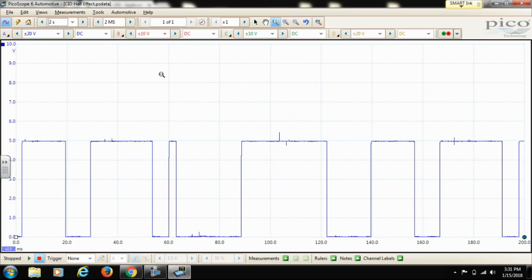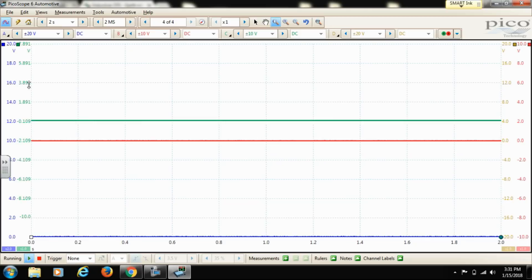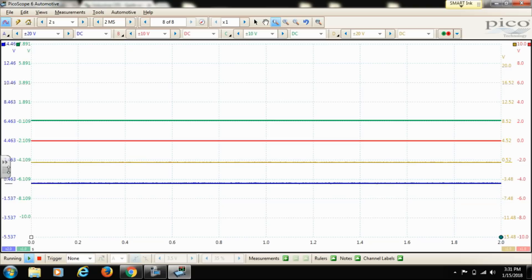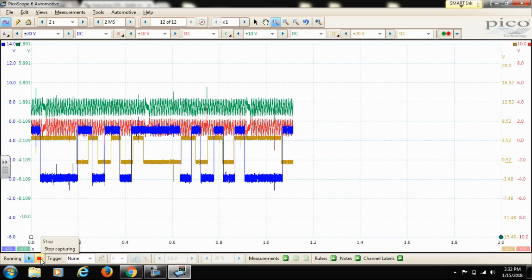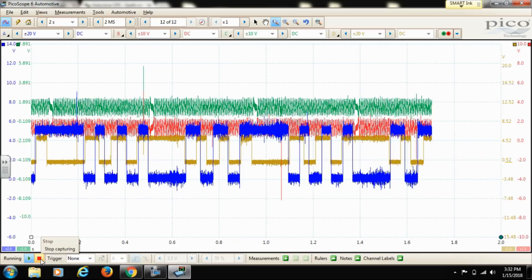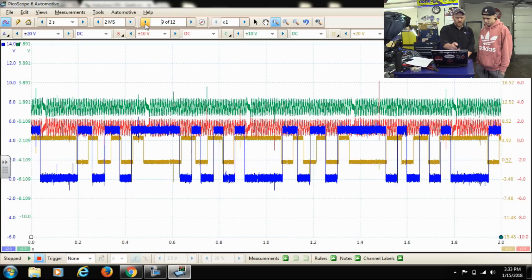So my scaling here — that's my zero line. There's my red and yellow trace. Should be good to go. Caleb, can you crank that for me? Keep cranking. Caleb's back — thank you for cranking. Up here at the top we have this waveform buffer — it's just like a rolling black box. These are the different buffer screens. I'm scrolling through — this is where you first started cranking. When you're doing this kind of analysis you want repetition. These signals are very thick because I have a lot of samples — I just didn't want to miss any detail.